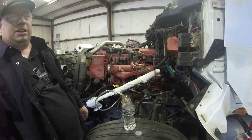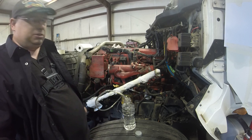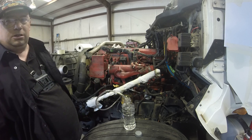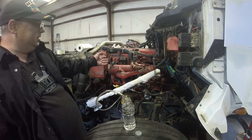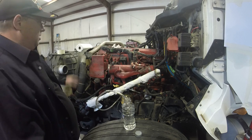That's definitely one injector. It's not like bloop, bloop, bloop, several sets of bubbles. It looks like it takes a couple of revolutions for it. I don't see a reason to replace those injectors. I mean, yeah, I got a tiny bit of leak, but this thing's still getting 8 miles to the gallon everywhere it goes. So I'm not going to change the injector.